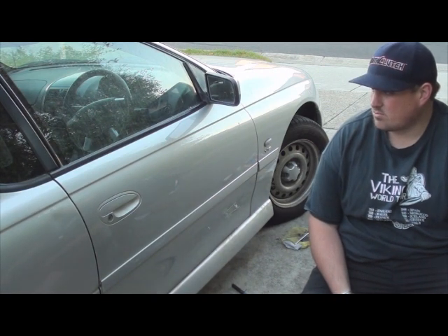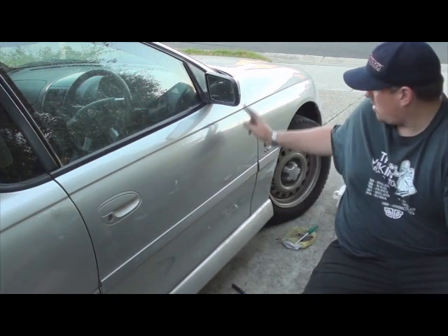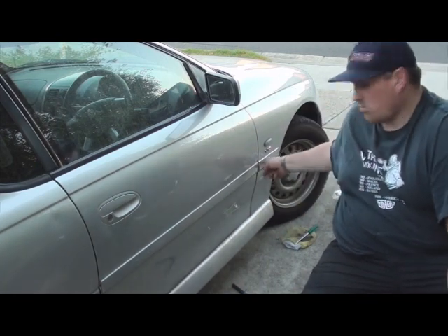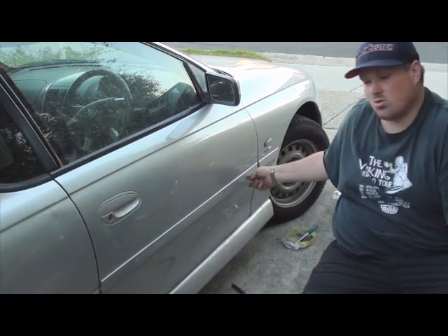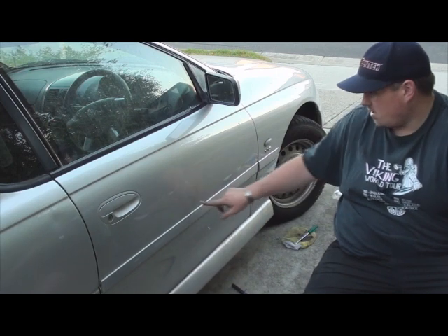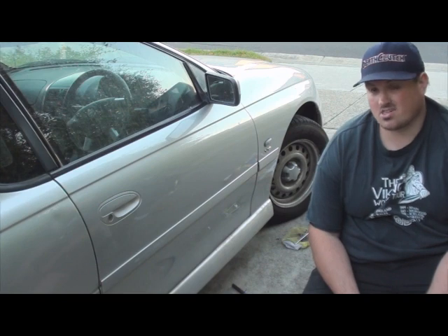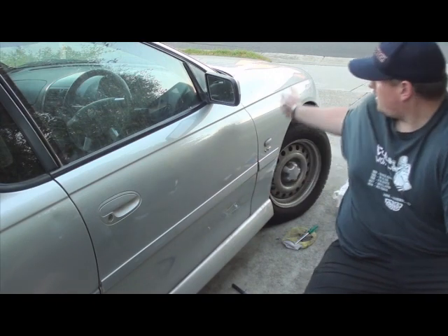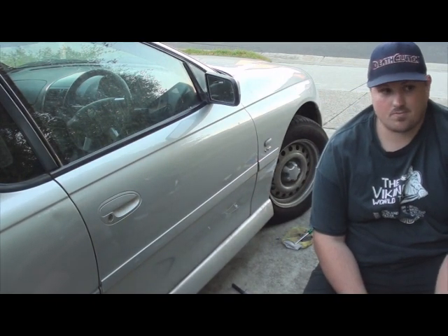Everything's going smoothly. I'll get it re-tinted at one stage. One other thing I thought of is that I said I was going to do another video on that quarter panel at a later date. Well, it turns out with the damage that was done to that quarter panel, I could not get the new door on without stuffing up the new quarter panel. And as you can see there's actually a little bit of a scratch there from when I was initially fitting them. So I had to end up taking the quarter panel off as well - just meant I had to take some of the skirting off and pop some screws out of the front there. Any questions, just shoot us a message or put a comment, whatever it may be. See you next time.